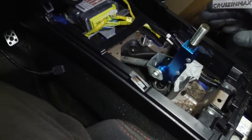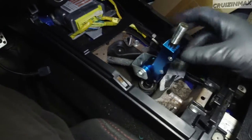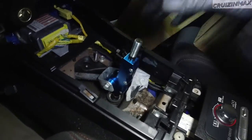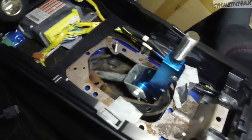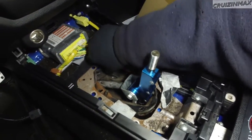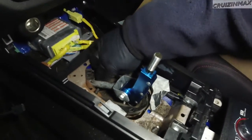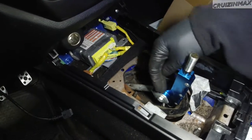The reason I'm getting in here is to replace the shifter — though I noticed it's already an aftermarket unit. I'm still going to remove it by undoing these four 12mm bolts. There's some tape over here. Once the four 12mm bolts are out, this metal piece becomes loose. I just took the rubber and shoved it down through so it doesn't catch when we lower the transmission. That should be it up top.